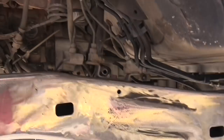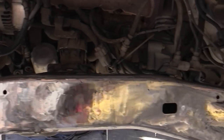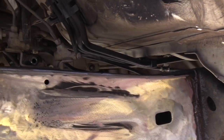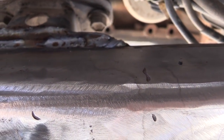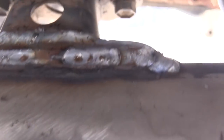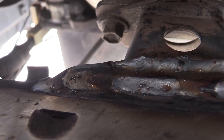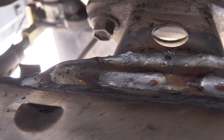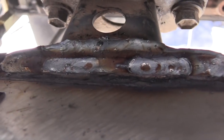Cut the other side, finished up yesterday. Looks like I missed a spot — gotta finish up these two little pieces on the corner, but it's pretty well done, nice and shiny. Gotta get the wire brush and clean that up a little bit. The way these are designed, if you want to cut that bracket for the shock mount flush, you have to cut into where the motor mount is welded to that bracket. This weld looks a lot better than the other one. I cleaned it out with carb cleaner, brushed it with a wire brush, cleaned it again. The other one wasn't sticking — there was too much stuff in it, so make sure you clean that out really well.